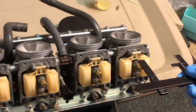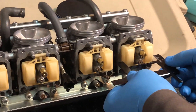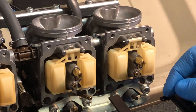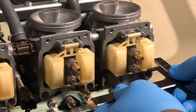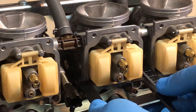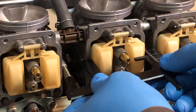I've checked all of these, so what I can tell you is that when I run the gauge over this float, there's just a tiny amount of gap between the top of the float and the gauge, and you can see that the float doesn't move. When I do it on this carburetor, the result is the same — this is an OEM needle in there, and the gap is the same, the float doesn't move.